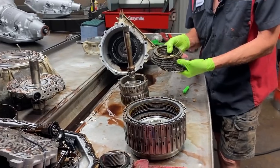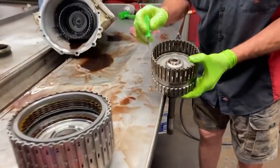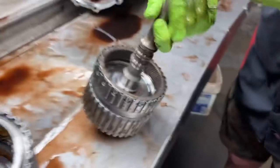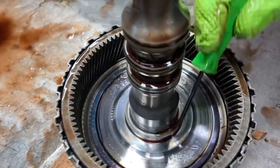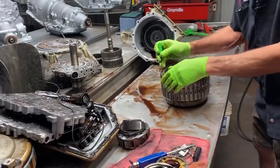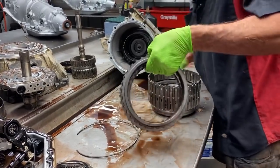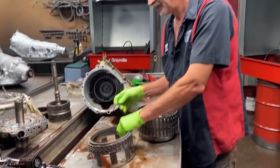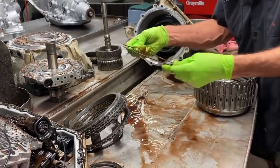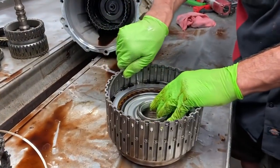That's why we buy our overhaul kits — we get the steels and all that, so we don't have to buff them, we don't have to worry, we're just going to replace them. Your overhaul kit will come with all these pistons. Once you get it together you can look in here for any type of cracks when you air check it. Always look and replace your rings. Okay, we get our third, fifth, and reverse clutch pack out of here — still looks pretty good. Keep your snap rings with them because they are different.